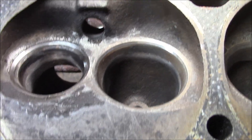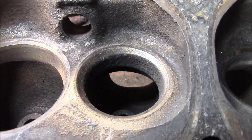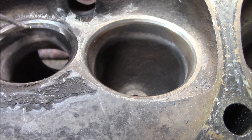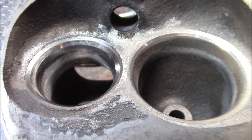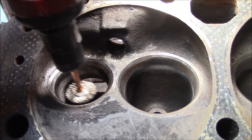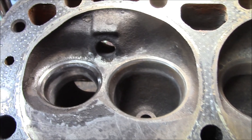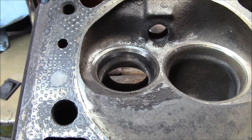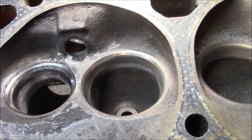Now for the exhaust, as you can see over here, they were really gummed up. If you watched my previous videos, you saw that when I did the leak down test the exhaust ones weren't in too good shape — because of all this junk. You can't even see below the valve seat, the second cut or the third cut. So I had to take a stainless steel wire brush and work all that gum off there. Since I'm going to lap the exhaust valve anyway, I would have just gotten the valve job too — it's pretty gummed up. You may want to be careful if you're using the brush, as it's pretty hard not to hit the valve seat. I did that on the exhaust but not the intakes. And I will be lapping the exhaust in a future video — maybe the intakes too; we'll see how much time I have.